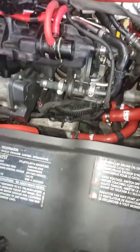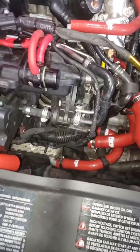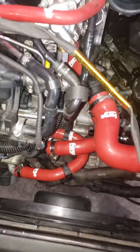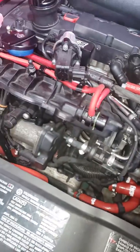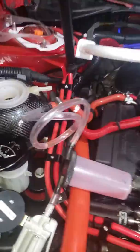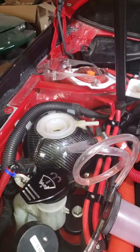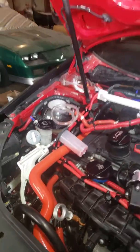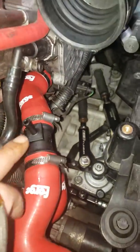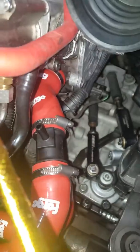Today I want to show a quick and easy way to fill up your coolant system on an MK5 — it'll probably work for Golf 4s, 6s, and 7s, pretty much any coolant system works the same way. Your coolant reservoir is going to be the highest point on the coolant system, so all you have to do is find the next highest point below the coolant reservoir, which on an MK5 happens to be this spout coming off the return line that goes to the reservoir along the back.